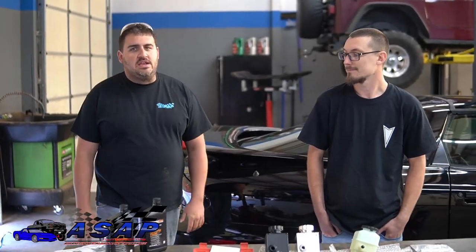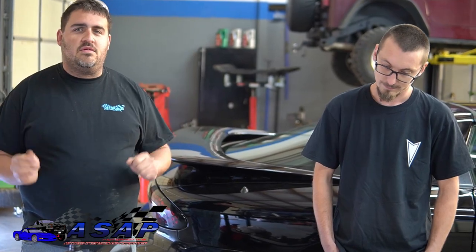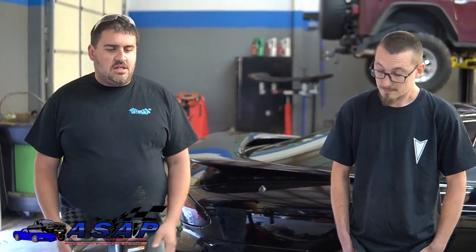We're back at it again today working on my wife's F-body, which we affectionately call the fire chicken. We're addressing one of the issues I've had — the power steering. I've already gone through a couple of pumps burning them up, and they're brand new pumps. We've already done the factory cooler removal and went to an aftermarket one, it's better but still have an issue. So about a year ago I started looking around because first time you do a couple of high RPM runs, the pumps smoke basically.